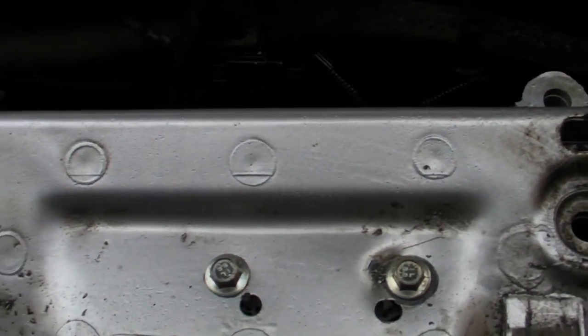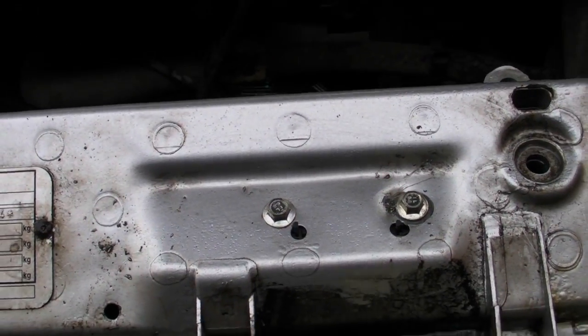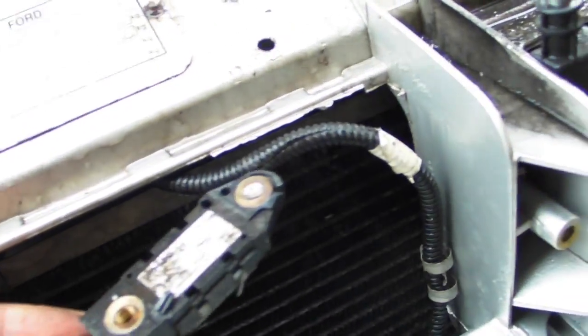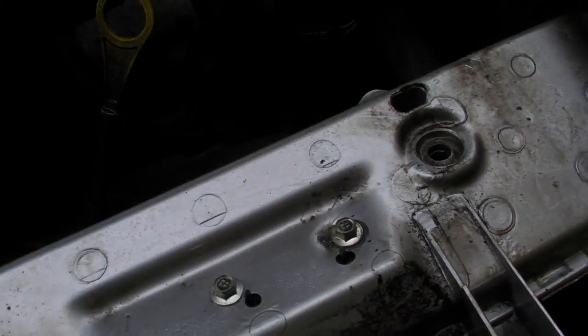So that's me having installed the new crash sensor. When you're putting it in — I should have showed you this before I turned on the camera — you plug it in and manipulate it underneath the front and slide it along so you're in line, then you catch it with the bolts and it goes up like that.